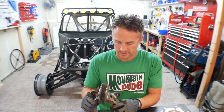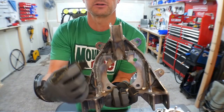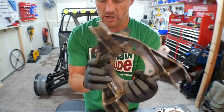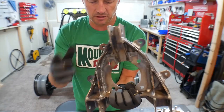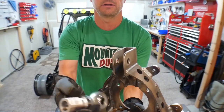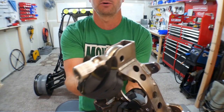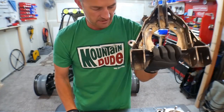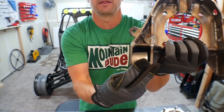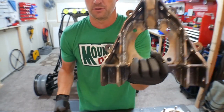It's going to be interesting when Ratchet is up and running — I will weigh Ratchet and I'll weigh Muller and compare the two to see how much extra weight doing stuff like this has added. When I was welding this together, I had spacers bolted in here and I did not unbolt them until I was done welding up the spindle so that these couldn't close up at all. The top is just wide enough for my 7/8 tie rod to go in there, and the bottom is just wide enough for my uniball and the cup to go in there — that's how I established how wide those need to be.